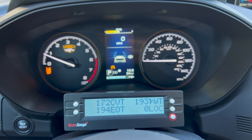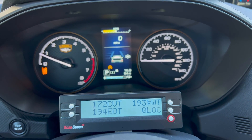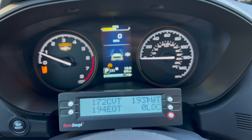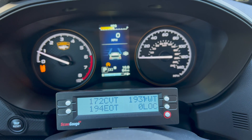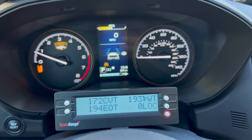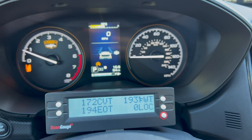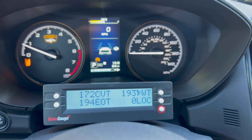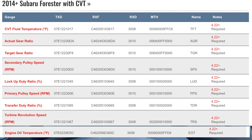This is how I set mine up. Top left, we've got the transmission temperature — I called it CVT. Top right is the default value, degrees Fahrenheit water temperature, which is the engine coolant temperature. Bottom left, we have engine oil temperature. Bottom right, right now it's displaying lock — they call it lock-up duty ratio — which is basically how locked your torque converter is. When it's locked, it's more efficient and you're generating less heat in your transmission, which is a useful thing to look at when you're off-road. Another one worth adding is actual gear ratio, which should display the CVT ratio it's currently in.